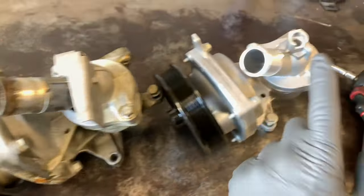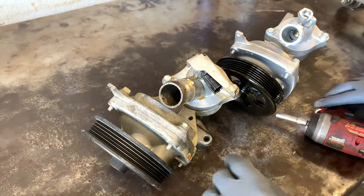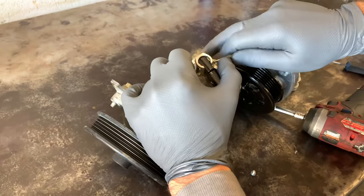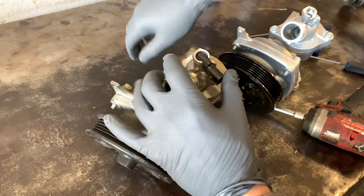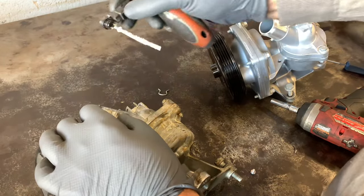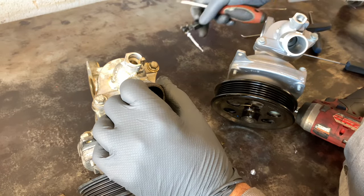Now we need to prep the water pump — we need to transfer over the temp sensor into the housing. This little metal bracket is a heat shield to protect the temp sensor. Remove the bolt with a 7-millimeter socket, slide the clip out, and pull the coolant temp sensor out using a flat-blade screwdriver. On some models this car does not have a sensor, and we ordered the water pump and thermostat for the one that does not — so when I went to transfer the sensor over, I realized it was the wrong part. The new thermostat housing was not drilled out for the sensor.